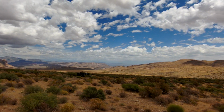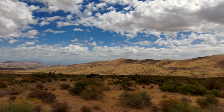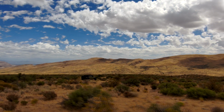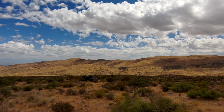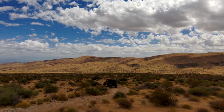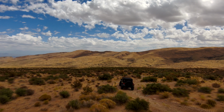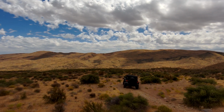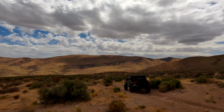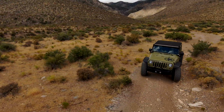If you're running there, you're fine. If you hit 235 every once in a while, you're fine. Don't panic. You might want to turn your air conditioner off. Like if you go to the Baker grade or some of these other grades around the country, they'll say at the bottom of the hill, turn AC off to prevent overheating. And yeah, Baker is below sea level, so it's in Death Valley. It gets really hot there, and you got a 26-mile grade that averages 6 or 7%, and that's going to be tough on the cooling system.